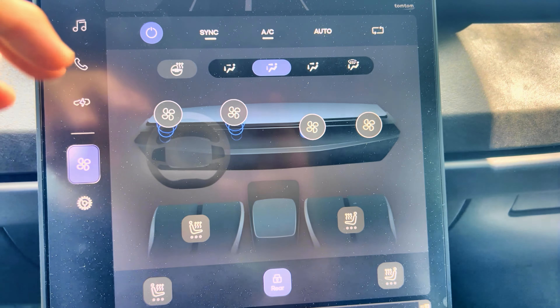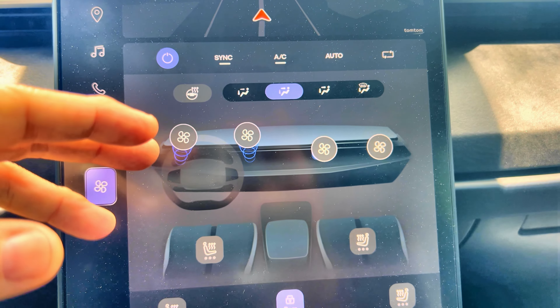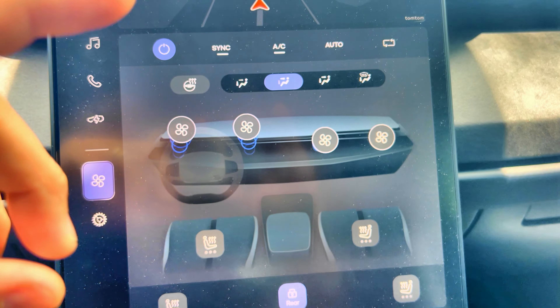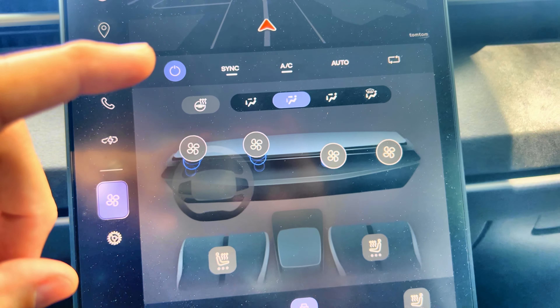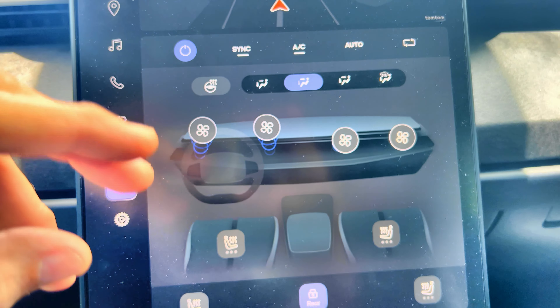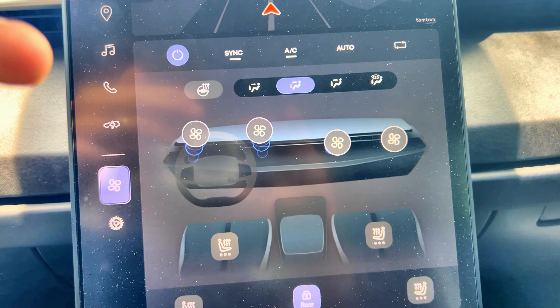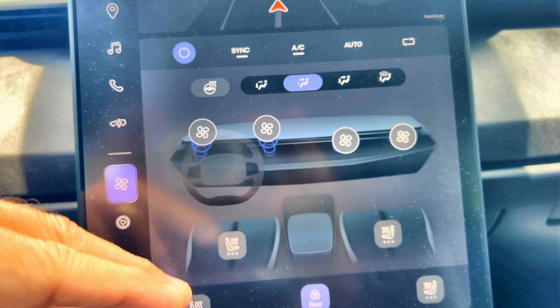This button right here — if you turn that off and the AC off a couple miles before your destination, that will help out the evaporator coils in the AC system. A lot of times there's a lot of moisture that stays on these coils.